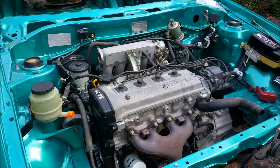Of course, on the exhaust system underneath, there is also the O2 sensor. I'll show you one of those. It measures the amount of unburned oxygen exiting the engine. And again, that can determine what the engine does in terms of air-fuel ratio. Again, as we said, we're looking for an optimal value of 14 to 1.